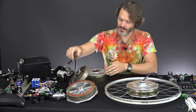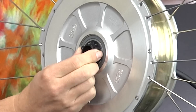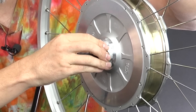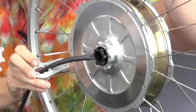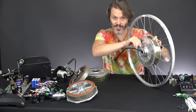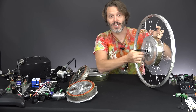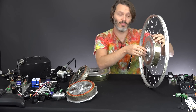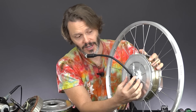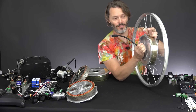The all axle design uses this for reactive torque — it transmits the torque to a torque arm. In this case, we are looking at their tricycle torque arm, single-sided mount. This keys in — as you can see, it has been machined on the inside — it keys into the interior axle. So all of your torque goes through here. The wheel spins; this axle does not. This actually bolts in. This is a much wider area to transmit your torque. You have multiple bolts, not just something slip-fit. Basically this transmits torque directly to the frame region. You can probably go a couple of years without even needing to retighten them.